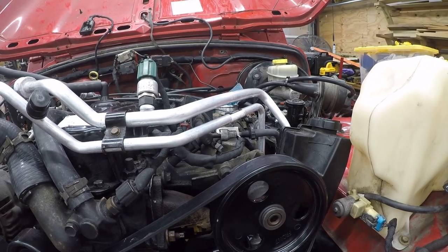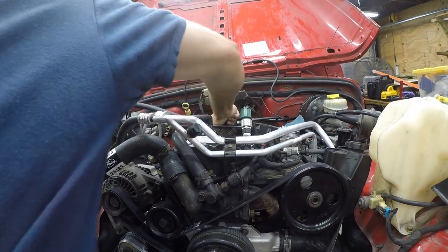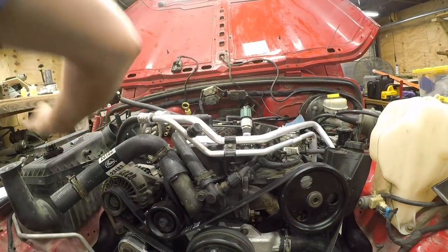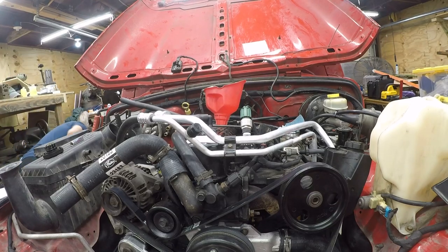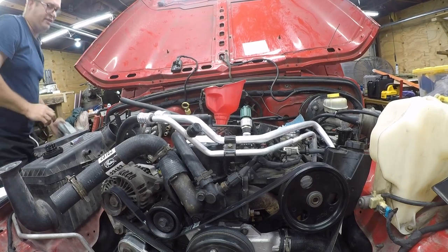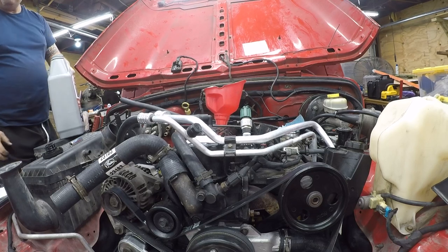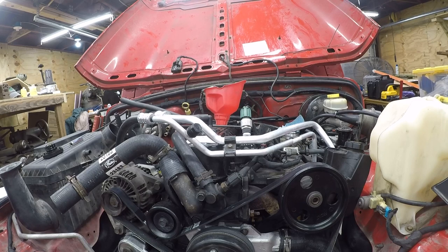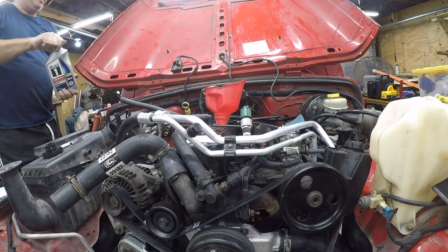I'm waiting on power steering hoses, and then I can install a radiator. I guess I could add oil to it. Yeah, I'll do that while I'm waiting. So hold on, I'll put the oil in. All right, so it takes 5W30, which would be really nice if there was a label that hadn't worn off. I don't know why they didn't put that up here. Pain in the ass. It does take 6 quarts with a filter change. I'm gonna need something to open this. Yeah, the Mopar likes their seals. First, I'm going to put the 1 quart in, and then we'll add the 6.